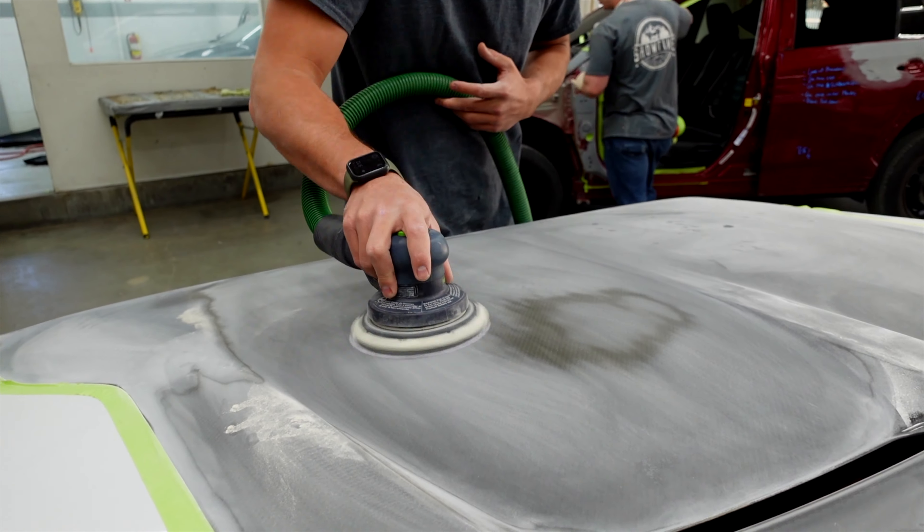When you lay the fine line tape down, you don't want to stick it inch by inch. You kind of want to pull as long and straight of a line as you possibly can and line everything up — just touch it to stop it where you want. When you make your curves, you just want to follow them around and move the tape. Now that the line is all laid out, it's just barely tacked down, so you want to come back and make sure you get it pressed down really tight and make sure it doesn't move once you've had it perfect. That's how you lay out a stripe.